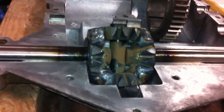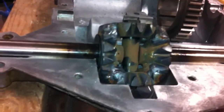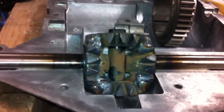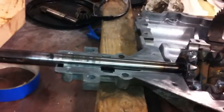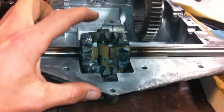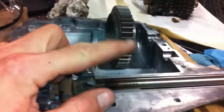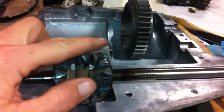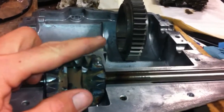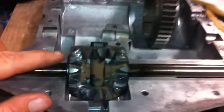I welded the diff a few days ago, and then I realized I kind of made a mistake. I noticed that I could push each axle in on the ends, and of course that makes the spiders push that way. I figured I'd have it nice and tight against the bull gear, but now that I'm thinking about it — that's got to float a little bit, so I kind of got a problem.